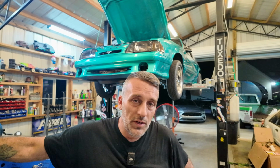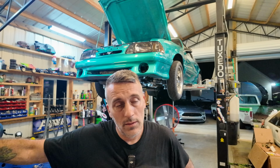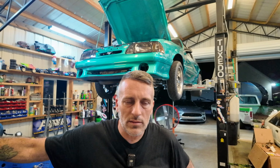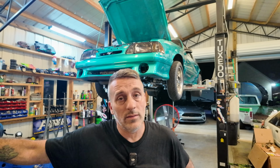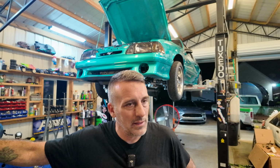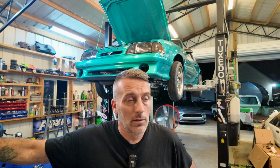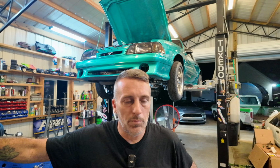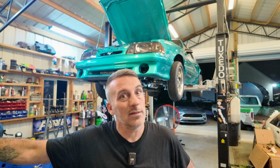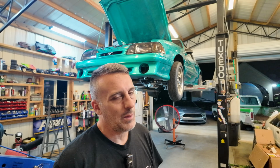I'm gonna go ahead and wrap this video up. It's been a hell of a day. I'll get back out here. Oh, I forgot to tell you, I did index the bell housing and it was about 6 thousandths off. 6 is close enough for me. Plus my dial indicator is not the best, and I did the best I could do, but it looks like we're gonna be pretty much within spec. So maybe a thousandths off, so sue me. I don't know what to tell you. I'm tired. If it was 10 thousandths or something like that off, sure. But being 6 thousandths, I'm not gonna worry about it.